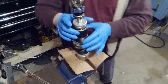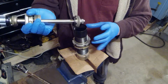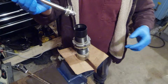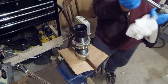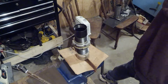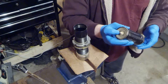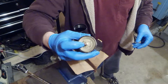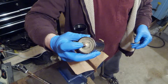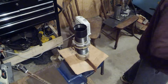Normally you have the reservoir still connected. You would want to make absolutely sure that you get all the nitrogen out of the reservoir, or as soon as you open this thing up it's going to spray oil everywhere. So you're going to release the nitrogen by pressing the little fitting — there will be a little fitting like this in the end of it. Press that and it will release your nitrogen charge, and then you can safely remove the shock head.